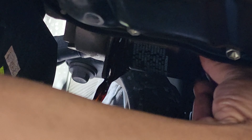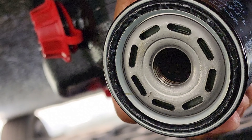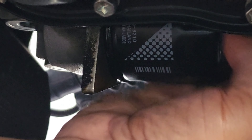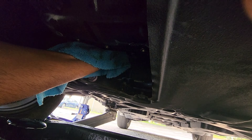You can also try to loosen it by hand — they're not usually too tight. If you use a towel and put a little strength into it, you should be able to take it out. That's the oil filter part number. As you can see, the original Toyota oil filter already has grease around the o-ring. Make sure the old o-ring doesn't stay there. You put it back on without adding oil into the filter — tighten it up. Use a towel if it's too slippery. You can see the oil is still dripping.